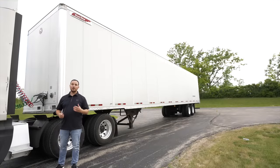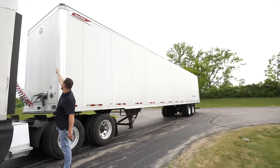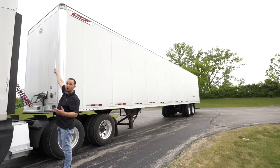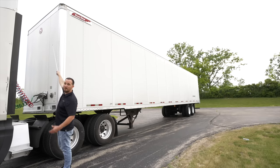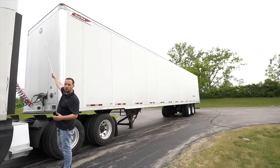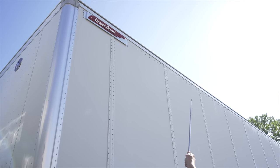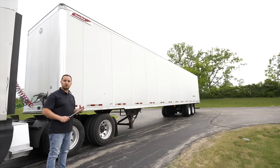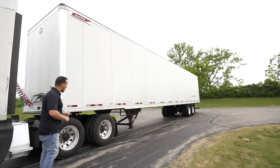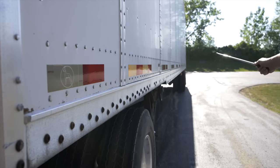Now we're going to inspect the trailer portion of the pre-trip inspection on the Class A tractor trailer. We're going to start off with the front of the trailer, from top to bottom. On the top of the trailer, the clearance lights are not broken, not cracked, on secure, proper color, and function as running lights. The front headboard of the trailer is not broken, not cracked, on secure, no holes, no daylight coming in and out of it. Then we're going to go to the side of the trailer, from top to bottom, front to back. I would check all my clearance lights — not broken, not cracked, on secure, all proper color and functioning as running lights. Then I would do all my DOT reflective tape on the side of the trailer — make sure it's clean and clear, the proper amount.